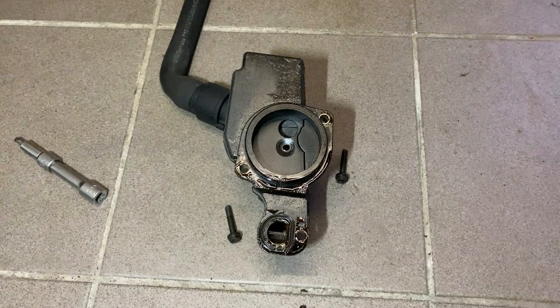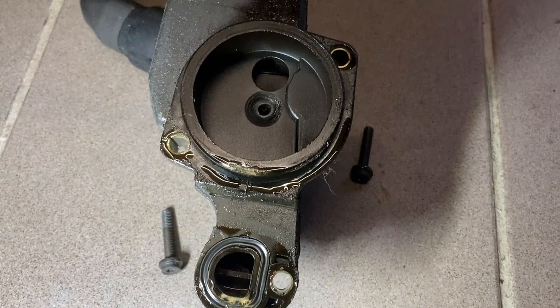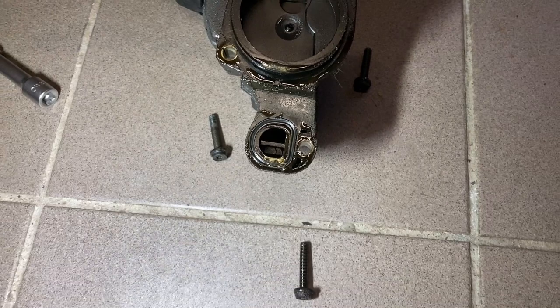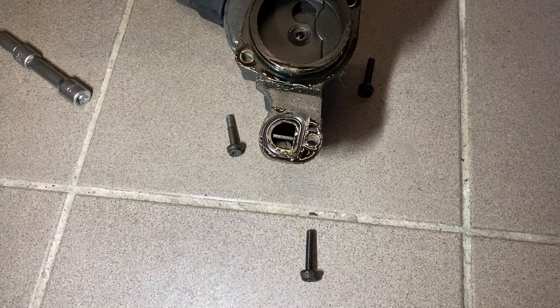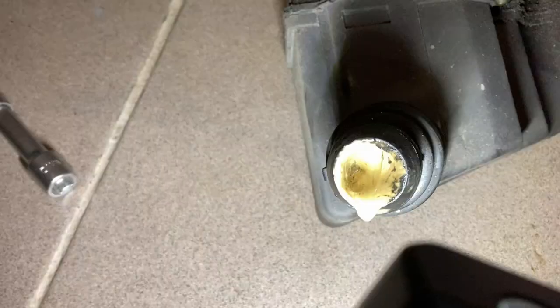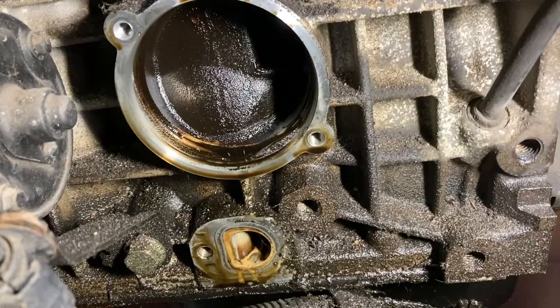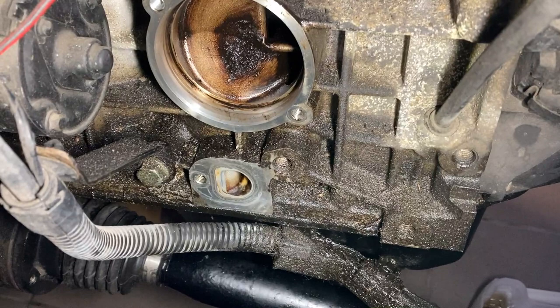This is the outcome — this is the oil separator. It's very nice that on this engine it's on the outside, not inside, which means with time it will leak — and as you can see, it was already leaking. The screws were not even hand-tight, very easy to remove. This thing is clogged. To confirm: there's not even a little hole there. This is how it looks from the top of the engine.